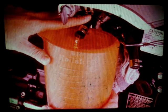To test the pressure regulator, remove the return fuel line from the fuel valve. Next, attach a length of fuel line to the valve and clamp it shut. Now open the fuel valve and hold a beaker under the return fuel line. Turn the key on. Fuel should pour into the beaker for 3 seconds.